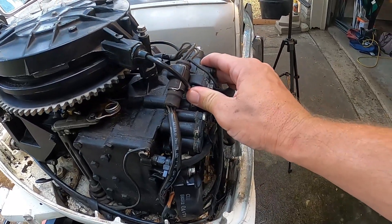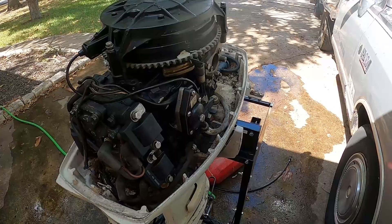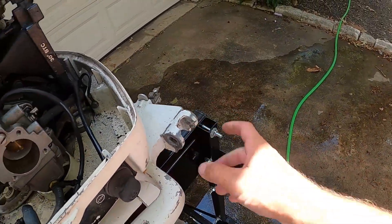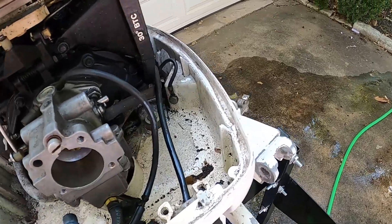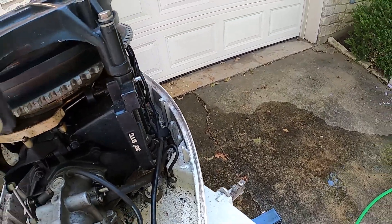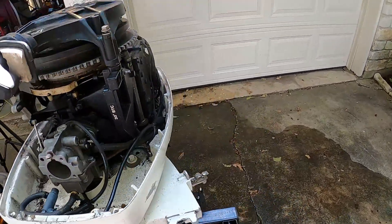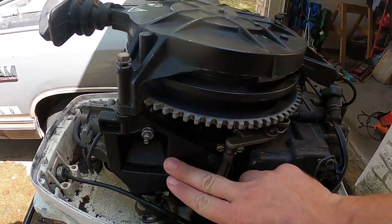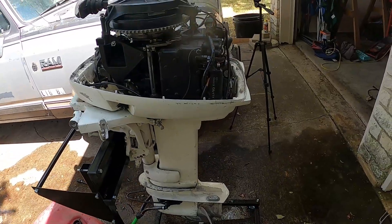The head is about the same — you should be able to put your hand on it and it should not burn your hand, and this is just lukewarm, so that's good. The same person that sold me the primer is checking to see if he has another tiller handle and the gear that goes with it so I can turn this back into a tiller motor. He also already said he has the whole kit to convert this to electric start, which I would 100% prefer — and it'd be excellent on resale too. Right now I'm pretty much zero dollars into this thing. I'm going to spend a little bit of money on the electric start kit — it comes with the starter, the button, the cables, and the wiring. I don't know if it's going to come with the rectifier or not, but either way it doesn't really matter.